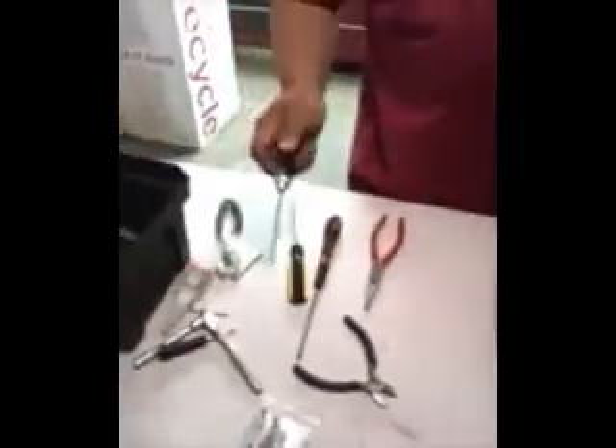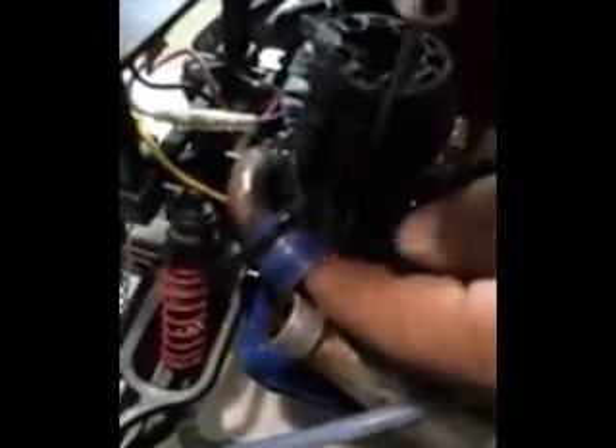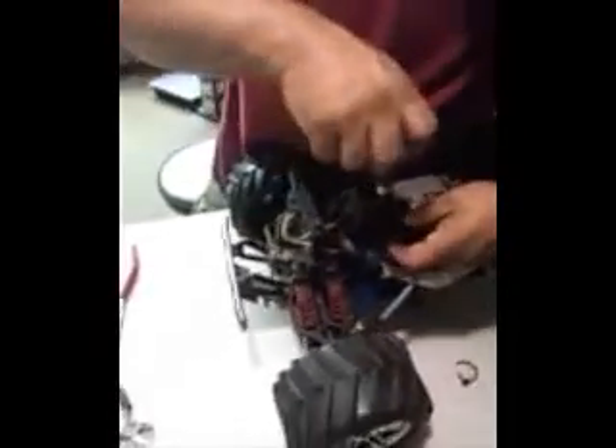Take your little tool and you want to take the motor off from the top. You want the motor mount to stay in place because it's already shimmed, so when you put it back in it's all ready to go. The yellow wire is the ground wire, so don't forget to put that back on once you put this together.